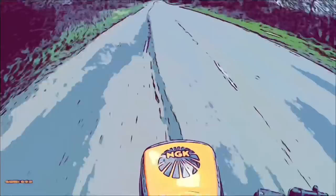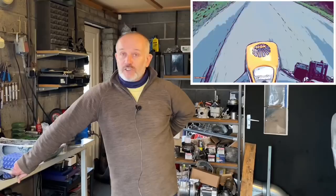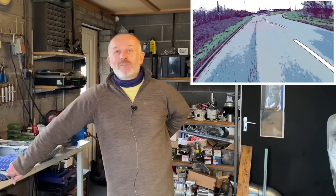As a result of doing that, we've ended up with a bigger engine, cubic capacity, because sometimes the guys down the pub want to be able to quote that they've got a bigger engine. As much as some customers, if they read the stats properly and read the horsepower figures and the dyno graphs and the torque results, would probably be more than happy to accept a 252, they sometimes just can't get over the hurdle of the fact that it's not a 265. This was something we wanted to build as a bigger engine, as a 265, and we've done it now. Got the 65 stroke crank in there, used in combination with the uni engine casing, and it has effectively made it a bigger and a better motor.